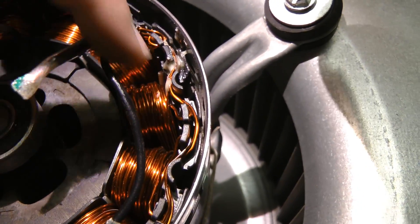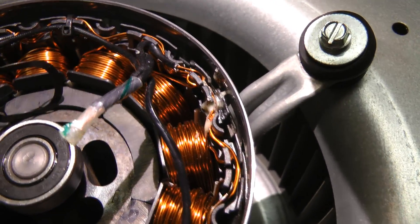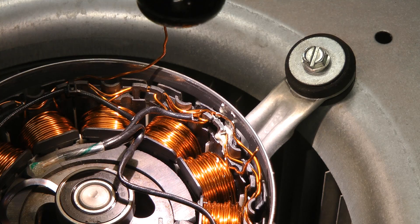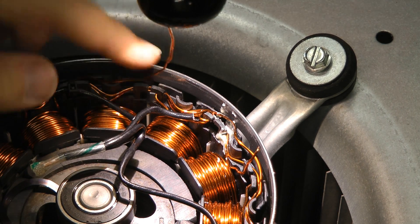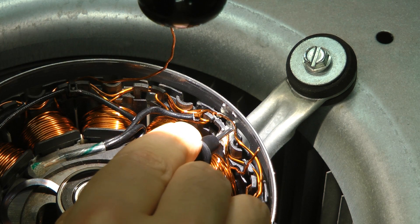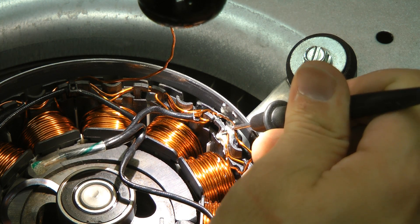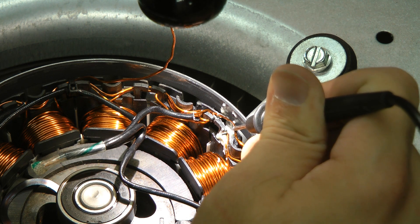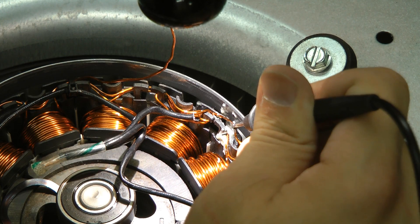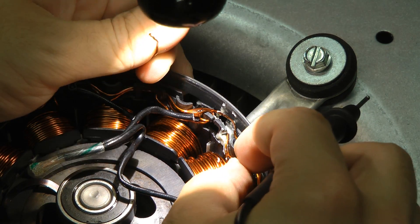This time I'm just going to cut the wire around here and re-route it far away from the shorts. It turns out that wire was not the actual source of the shorts. But after digging around more, this wire — you can clearly see — has a break in the insulation. So hopefully now that we've lifted that out, that will solve the problem. I just have to reconnect this back up again.